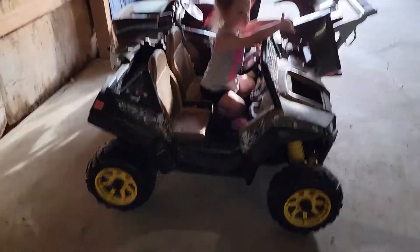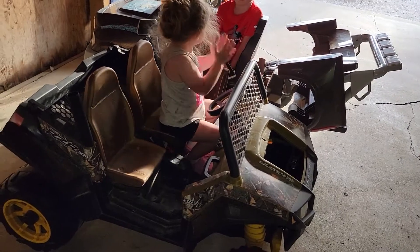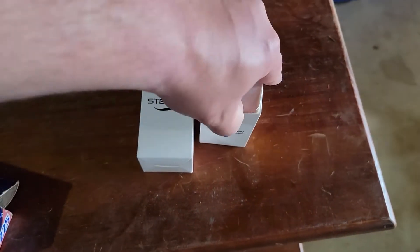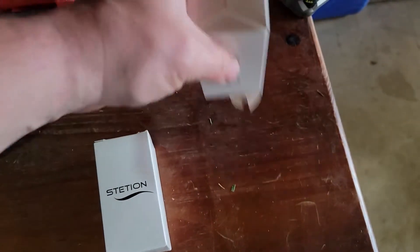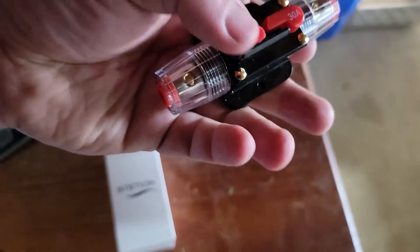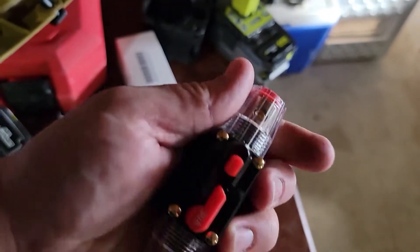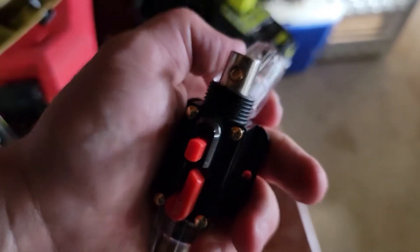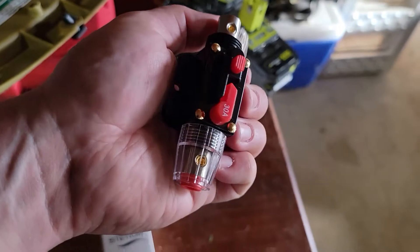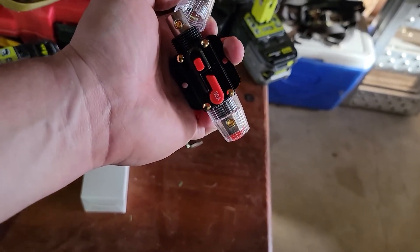These kids are driving these trucks and just going through battery after battery. It just got way too hot. So what we're going to do — a lot of people are putting fuses in these things and they just do a 30 amp inline fuse, but we have something a little bit different. Because I anticipate blowing that fuse quite often, we have these inline breakers instead. These are actually made for car audio applications — this is a 30 amp breaker. All it does is trip the breaker and then you can reset it. You just put the wire on each side; it has an allen screw for you to tighten down the wires. All you do is take these end caps off and you can access the screw. It even has little o-rings for whatever amount of waterproofing that provides.